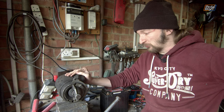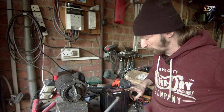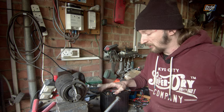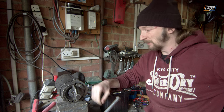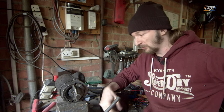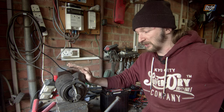With the starter motor in our bench vice we can do a proper test, making sure we're connected to the right terminals. We had the positive connected properly onto the positive terminal on the side, the negative onto the little post on the back for the earth ring terminal. We ran it up, a bunch of current flowed, we saw the battery terminal almost melting with a huge amount of current going - but there wasn't even a peep out of the solenoid, no click, no movement. We reckon this thing is jammed up hard. They are possible to rebuild, but that depends on knowledge and parts we don't have, so we're probably going to send this one in for a refurb rebuild.